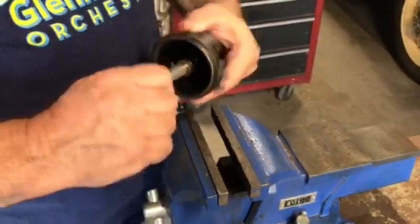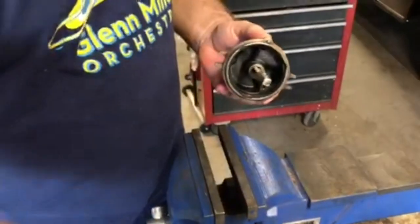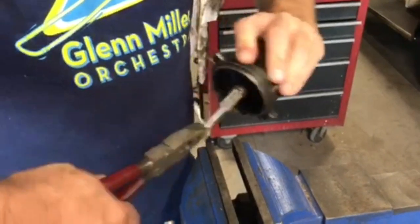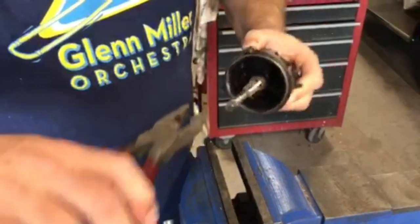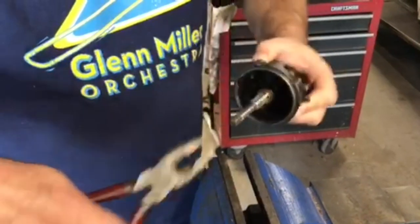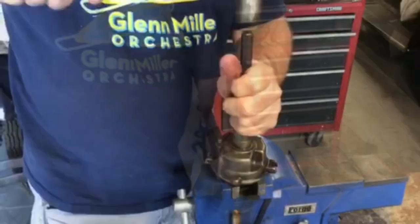Let me give you a little detail of what Bob was talking about to get the bushings out. Take a half-inch tap and run it into the bushing — only do one at a time, either the upper or the lower first, don't do them both at the same time. Run the tap in until it's firmly seated, then put the distributor body on a vise and tap it out using a punch. A few gentle taps later and it comes right out.